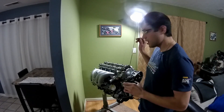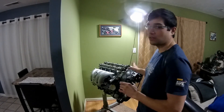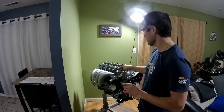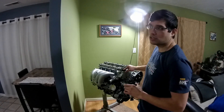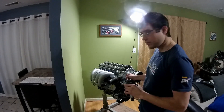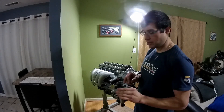All right guys, we've seen it from there. Cams are in, timing marks lined up, chain on, tensioner on, front cover on. The top bolts are 4.6 to 7.2 foot-pounds. The camshaft sprocket bolts are 125 to 130 foot-pounds. The tensioner bolts are 4.6 to 5.5 foot-pounds. Front bolts I haven't done yet - I'm pretty sure they're 12 to 16 foot-pounds. And now we're going to pop the distributor in.